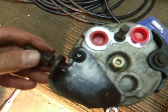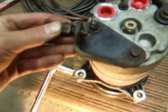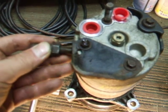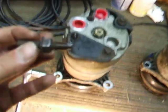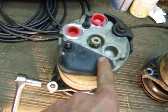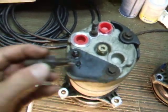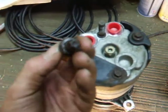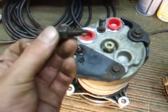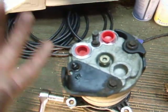I figured maybe that's why they say to remove the tensioner. I moved the belt tensioner at the front, so it went from about a quarter inch too long to an eighth of an inch too long. Just maddening. I couldn't get those two bolts off easily either. But then I noticed there's a Torx fitting on the end of the stud, so I tried it and got the stud out. Once I got the stud out of the engine block, it was easy as pie to take the compressor out.